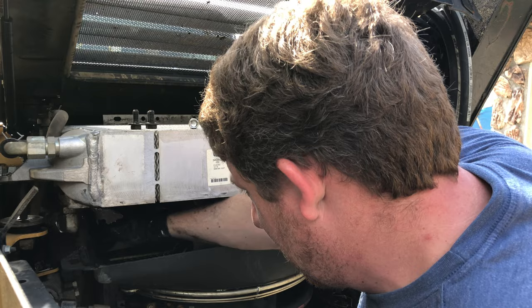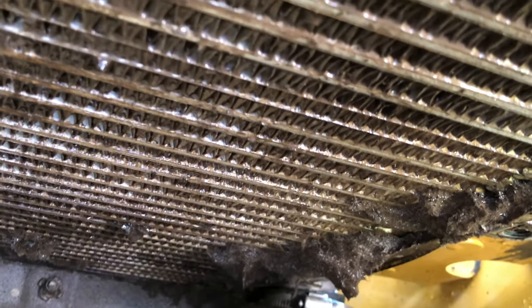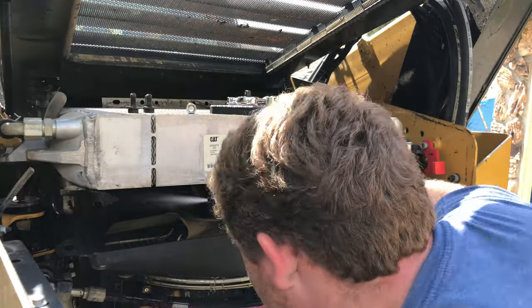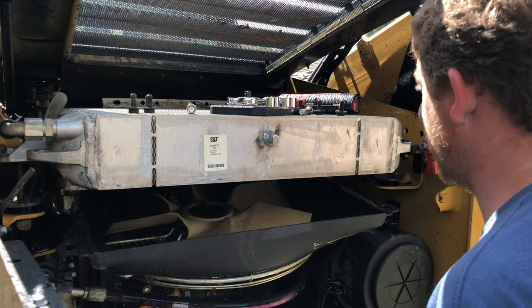I am glad I did this, because it is full of stuff. This is after a couple of cleanings before today, and you can see how badly it's just caked in here. No matter how much pressure I put from the top, I just wasn't clearing these. That's why I needed to drop the shroud and clean it from the bottom. You can just see it's caked in the corners where I couldn't really get the hose into, and the whole channel is just completely blocked. Big chunks — lots of big chunks.